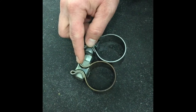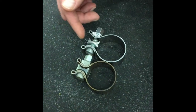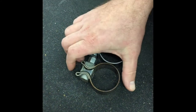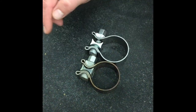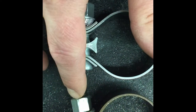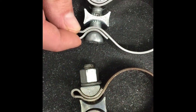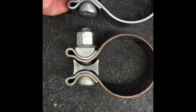These clamps do go bad. What happens to them is that the metal stretches out. Obviously they get hot and cold — it'll kind of anneal the metal — but what happens is they end up stretching out. Even though you get this nut really, really tight, there's going to be a point at which these areas are not going to compress down anymore. They're going to be stretched out, pulled out.